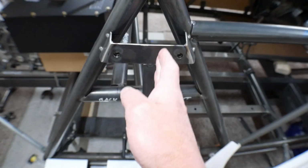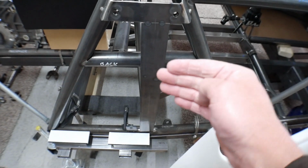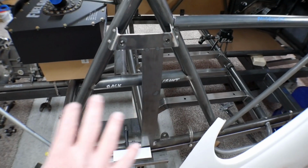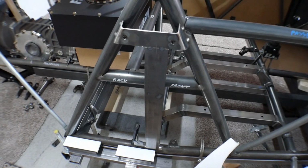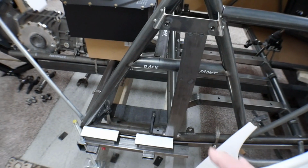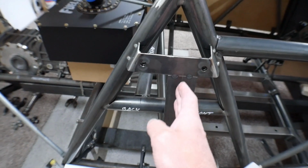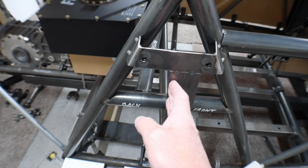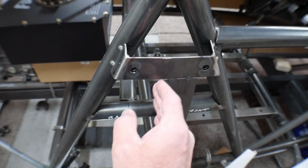And this is in the exact same location on a regular Volkswagen body where the door and the quarter would meet, because if you remember, the base dimensions of this chassis are the same dimensions as a Volkswagen bug chassis. So what I'm going to do is set the panel up there, center it on here, and then take it probably 1/8 of an inch back because I want to leave some distance between the quarter and the door.